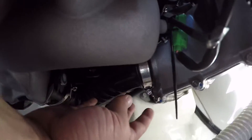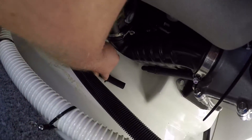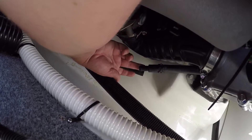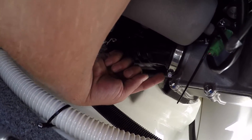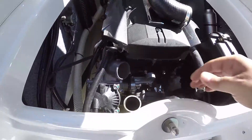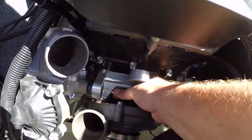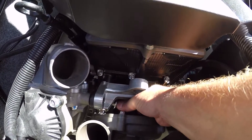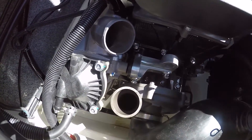This is the bottom of the intercooler. The water line connects right down below there, so I took it off at this coupler — it's a lot easier to take it off in the air. Once I get the intercooler out I'll take it off from the bottom and swap it over, then attach it again at the coupler. Make sure not to drop anything down into your supercharger — that would be really bad.